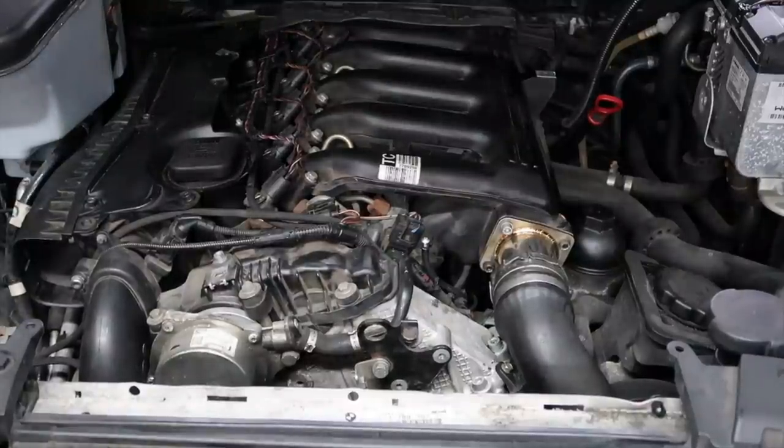I can safely say this engine is running much healthier. The turbo sound is a lot better than it was before — the turbo sounded like it was struggling and whistling a lot because it was all bunged up and clogged. This has made a total difference to the way this car and engine sounds. I'm very happy I blanked off the exhaust side because that bolt kept coming loose, and I think that was the main reason we were hearing the turbo whistling. If you have a turbo whistle, check that lower bolt on the manifold.